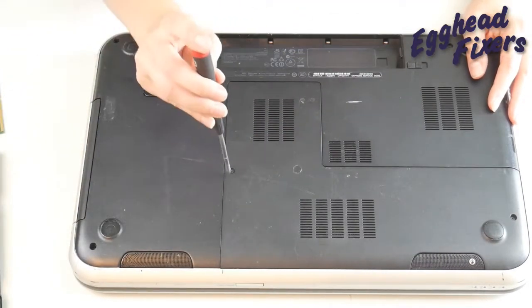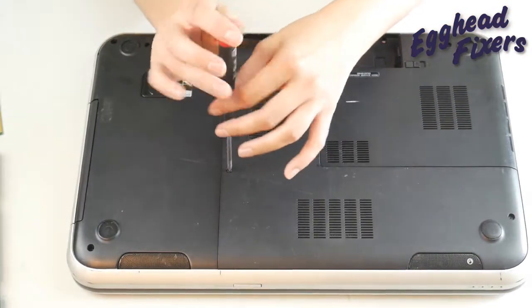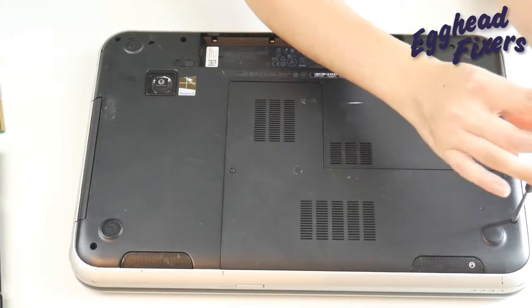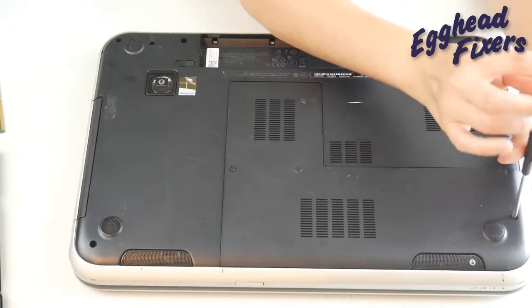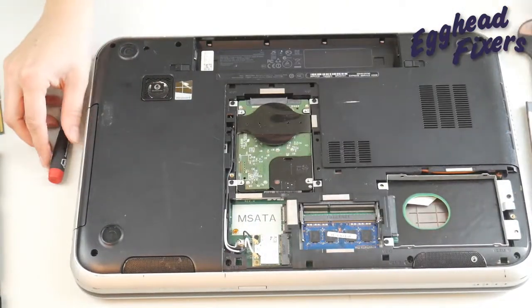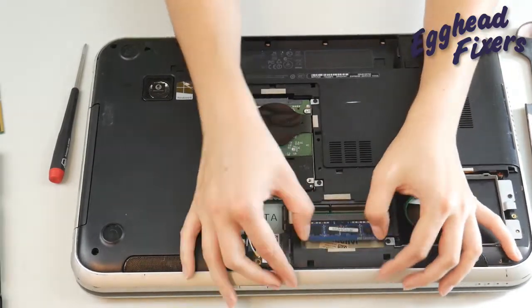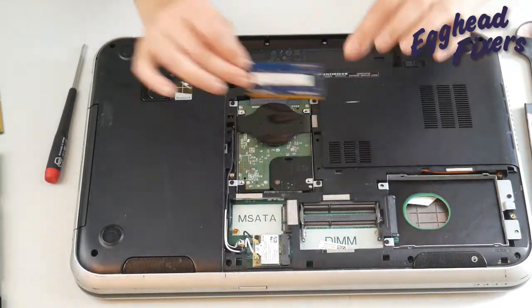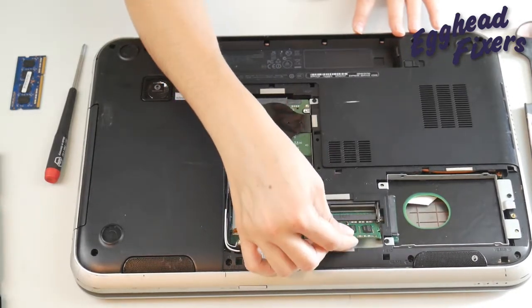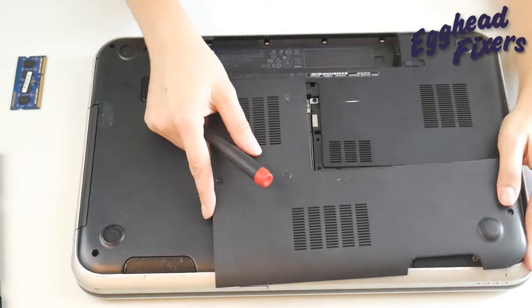As a quick shout out, occasionally it can be a problem where your RAM is loose, so you may just need to reinsert both RAM sticks and see if it turns on. This is a less likely scenario, but it's always worth checking. Once you get back into your computer, you're going to take that other RAM stick out, just like so, and put the other RAM stick back in — because it could be that one of these sticks has gone bad. So we're going to try reversing it, and we're going to put the panel back on.